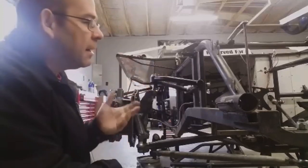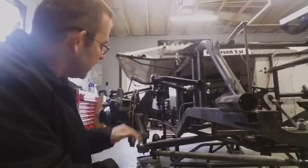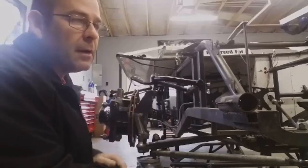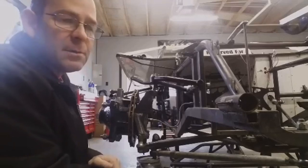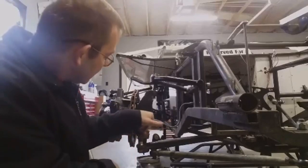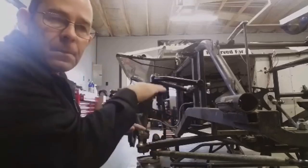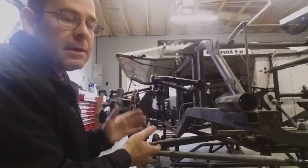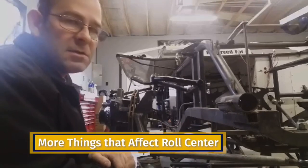That will give us greater camber gain — as you've all seen, the massive right front camber gain we get in these dirt late models. The other thing that changes the roll center is the spindle. Guys like Tater Masters design their race cars with a specific spindle they want you to run for a reason — matched to the horsepower, the motors, and the tires those crate cars use. Spindles have different degrees and different pin heights. Pin height is measured from the lower ball joint to the center of the hub. On this car the right front is two and a half inches and the left front is four and a half — that's a drastic split. You just can't throw any spindle on a race car; listen to your chassis builder.